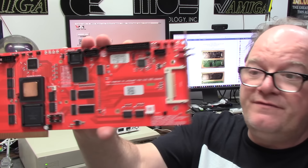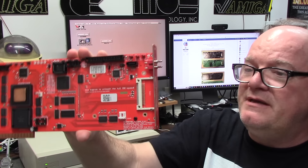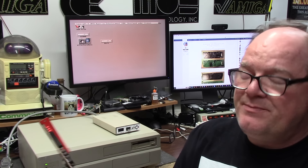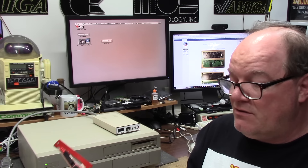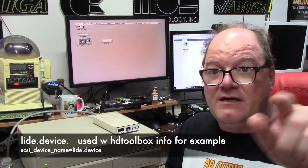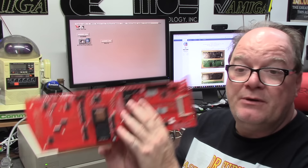It has power headers for various devices and even comes with a little screw thing for your NVMe. Compact flash solution, IDE. Now, it has a special device driver built into its ROM called LIDE.device, so you have to make sure that you are using that in your hard drive toolbox — like SCSI_device_name equals LIDE.device, built into this.